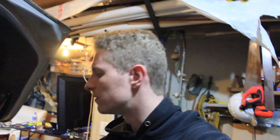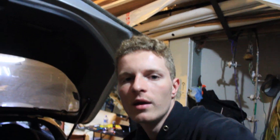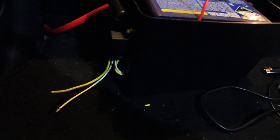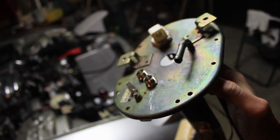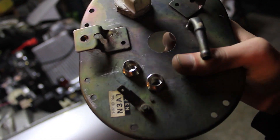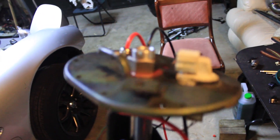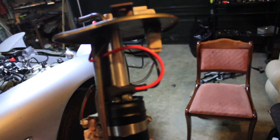I've gone ahead and wired in 10 gauge wires to the pump - positive and negative. These are going to run to a relay so it just gets better voltage. If you guys want to do the same thing, I'll attach the wiring diagram - it's quite easy to follow. I drilled through the top of the fuel hanger to allow for the fittings, which are going to seal around the wires from the pump. It's all wired up, threads through the fittings, and the pump is tightened and ready to go in.